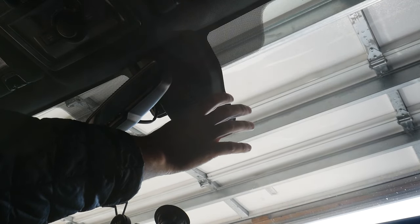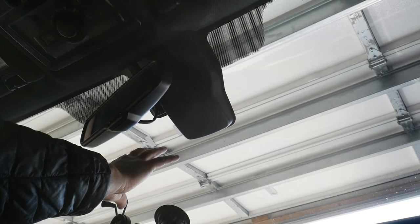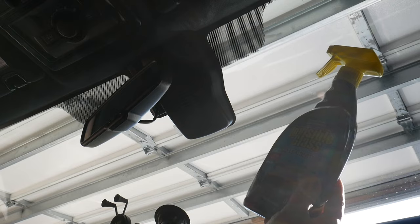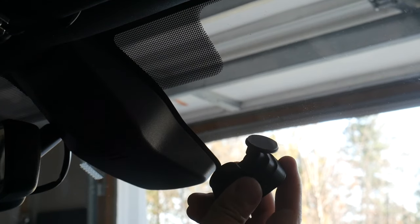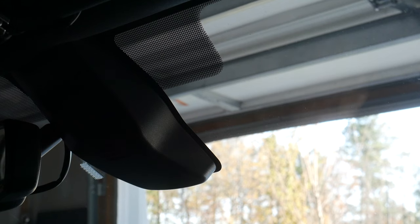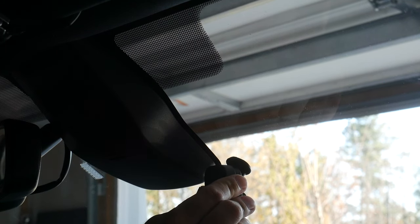Next, pick a spot for your dashcam. I'm going to put it behind the mirror so when I look I can't really see the dashcam and it won't block my view below the mirror where my usual visual is of the road. I'll go on the passenger side, right of this column, and put it right here. Spray a rag — I like this invisible glass cleaner — and just clean up the spot. Let it dry. Once the window is clean, take your camera and make sure that ball joint is nice and straight, because this is going to go on the window. Bring it down a little to make sure you don't block the 140-degree wide angle lens. Take off the backing and stick it right there. Give it a press, maybe five to ten seconds, and you're good to go.